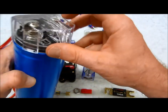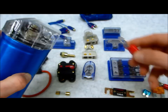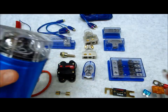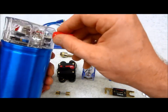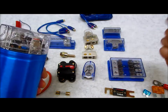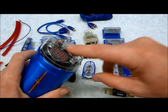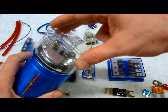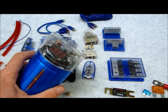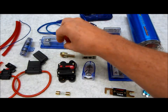But they're really cool because up on here, you can see they have these little lugs, and you can get a lot of stuff on there. So say if you have 2 amps, which my video is basically geared towards, you can have your one audio running input here, you got 2 more rings, and you could have one going to your 4-channel amp, another one to your sub. Mount this up in there, you get a nice little effect from having the light. You put this in there, it looks wonderful, and it helps supply a little extra battery as a surge when needed for your amplifier that draws the most current. Like I mentioned, most likely, of course, your subwoofer amp.